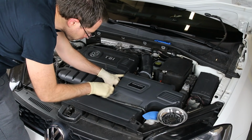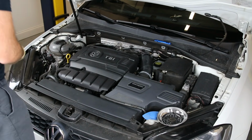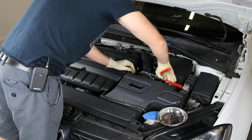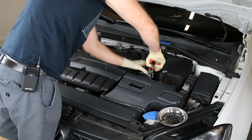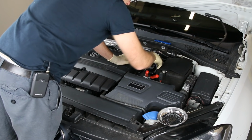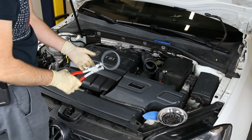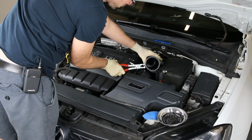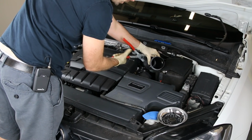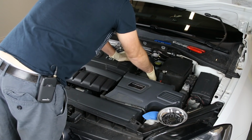I'm going to remove this secondary air pump hose from the side of the intake here. And now we're going to take off this clamp here. These spring clamps do have special pliers, which we do offer, so you can use them instead of a regular pair of pliers. You will struggle oftentimes with regular pliers because of the style that they hook on, so it'll be hard to keep them in place if you don't use this type of plier, but we will link to them in the description if you'd like them. If not, again, you can try to use a regular pair of pliers. It can work, it's just a little more challenging.